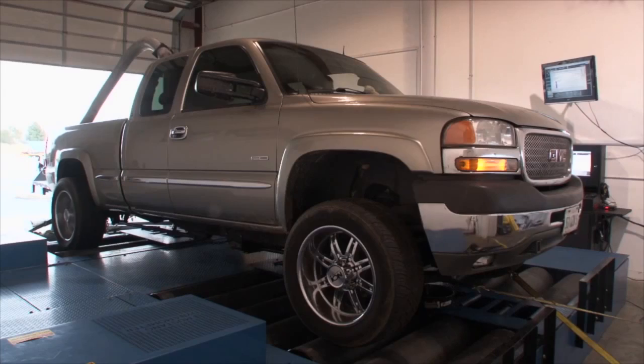The way that we do that is by making sure the truck has a load on it when it starts a dyno run, making sure the load is appropriate on the dyno cell, and making sure the test RPM is through an appropriate window. We're gonna run the truck from 2600 RPM to 4100 RPM over a seven second window. We'll bring the truck up to about 350 horsepower at 2600 RPM before we start the test.